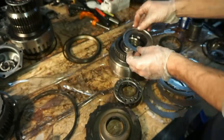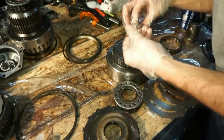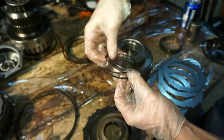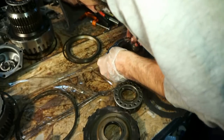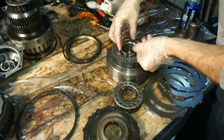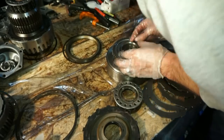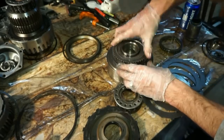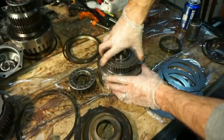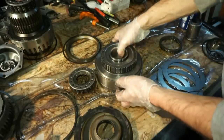We're going to put this retaining plate on. And then next we have this spiral snap ring. So the snap ring is actually two full loops and it's spiraled. So we'll put this thing on. Make sure that ring is seated inside there. Now this doesn't come out. It's not going anywhere. We got clockwise, spins, doesn't spin counterclockwise, so that's good to go with the new piece.